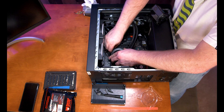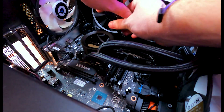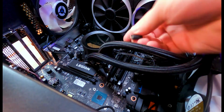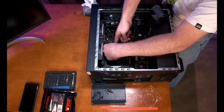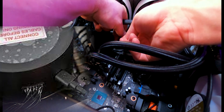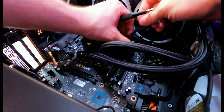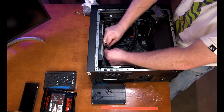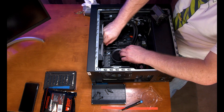We're going to add the four nuts in a square pattern — start one nut, go diagonal, start another nut — hand tighten them all the way down until snug, then screwdriver them the rest of the way. Following that square pattern is very important to get even, constant pressure across the IHS and heatsink so the thermal paste spreads evenly and fills any gaps. Then plug the USB micro back into the top of the AIO cooler and pump, do some wire management stuffing wires above the memory and radiator. The last wire to plug in is the PWM fan header to the CPU header on the motherboard — it allows the motherboard to know it has a pump or fans it can use to cool the CPU.